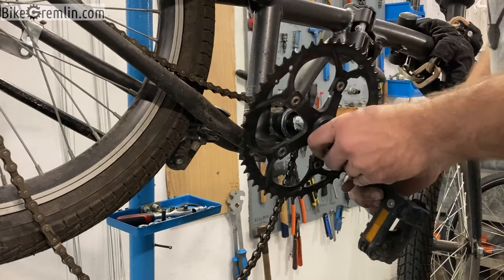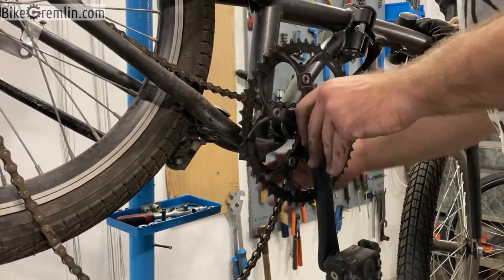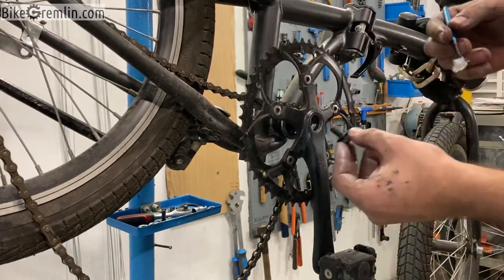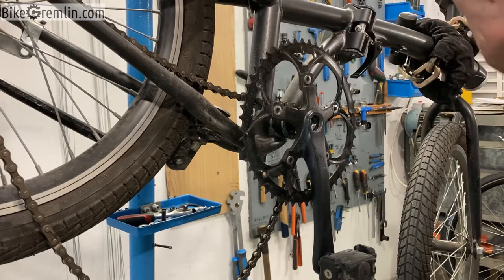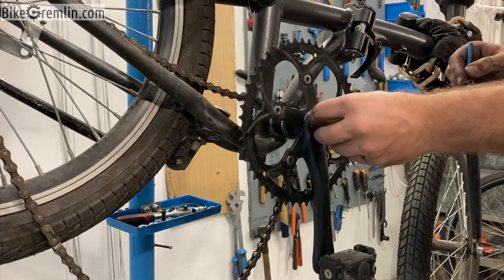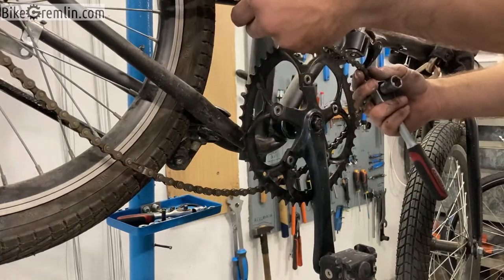The concern is that because this crank cannot be removed later, we are working with what we have. Using a shorter axle I'm afraid the crank will not be pushed hard enough as there's not enough engagement room. Now time to put the screw in — I'm also putting some anti-seize on it to make sure it provides proper torque. Let's see what this looks like for chain line.